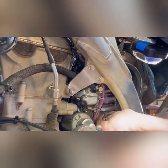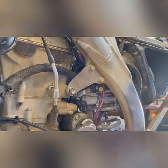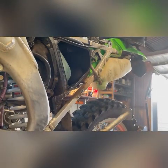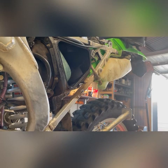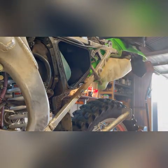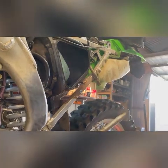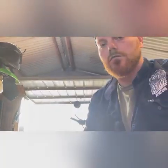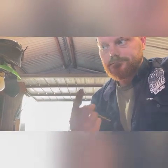By loosening this, I should start to see fuel pour out down low, which I am. See it pouring all there, all over my thing. It's going to go out the driveway. So I'm going to get a rag on that. Precious fuel ain't cheap. Now, once all that fuel's drained, I'm going to remove the bottom socket cap, and that'll give us access to the main jet, and we're going to replace it with the 170,